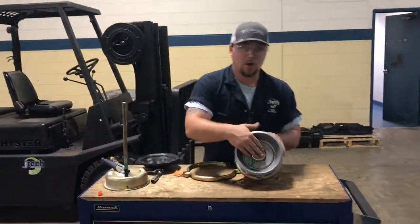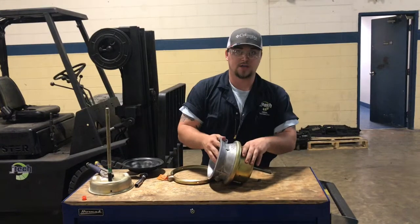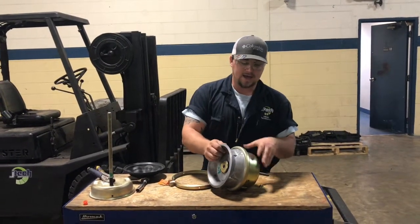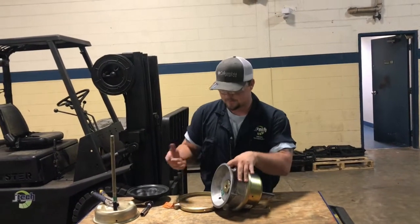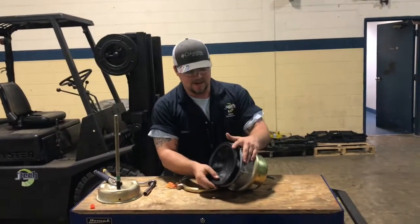Here is the side that you would have your parking brake on, because this is where your 1,800-pound spring is. We have it caged because it is very deadly — you can kill somebody if it didn't work. So if you're rebuilding one, you would replace just that diaphragm.